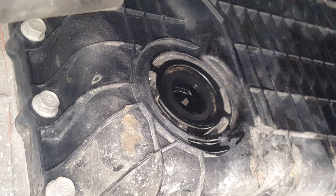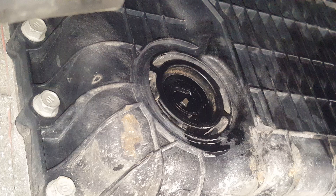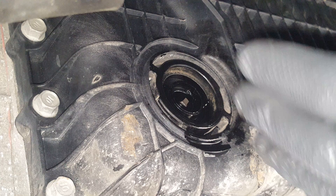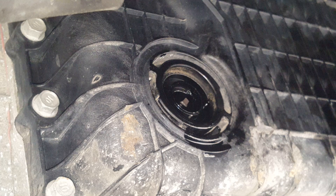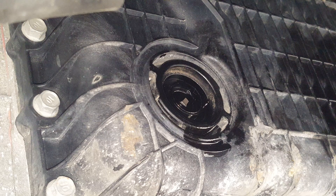The beauty of this is if we pump the fluid in here, we can also check it here. We're going to start pumping it in and get as much as we can. Now the thing about it is it's going to start draining out, so we want to go kind of slowly — we'll get a quart, maybe two, in here. Then once it starts drizzling out, we're going to stop and crank the vehicle up. Keep in mind, you're going to have probably another four quarts of transmission fluid in there, so we're not in any danger. Once we get it coming out a little bit, we'll go ahead and crank the vehicle — we've got it level and we want to get it running and circulating.